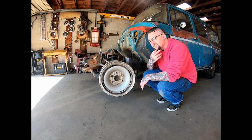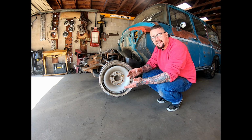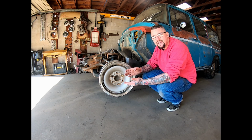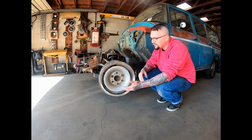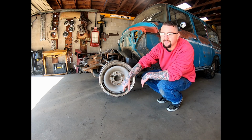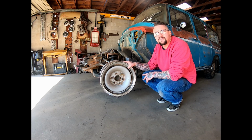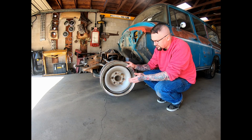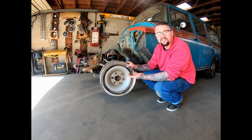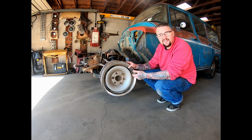And I thought that was interesting, because I just assumed being 16 and 6-lug, they'd be an 88 to 98 Chevrolet. If you know the normal half-ton wheels that came on those, they actually had several little slots around the top of the wheel, not just 4 large ones. And after doing a little research, come to find out these are from the heavy half-ton. So they're, to me, an old school looking Steely, but they're the right bolt pattern for us. And being a 16, they clear the ball joint and the brake caliper.